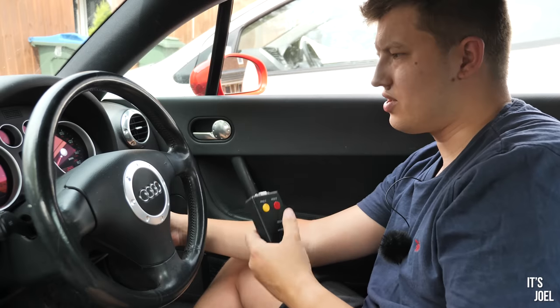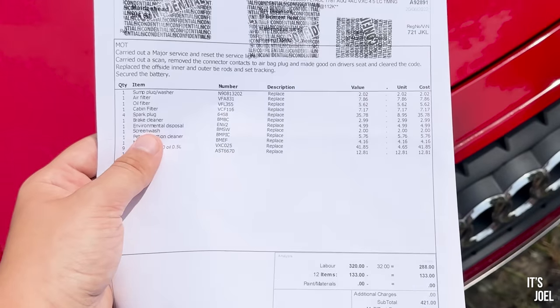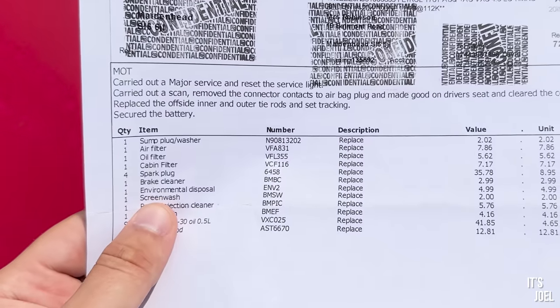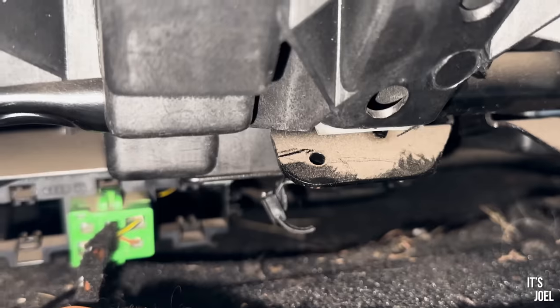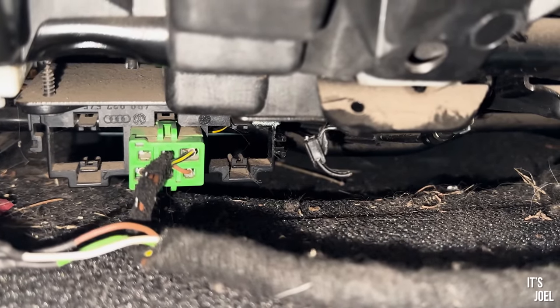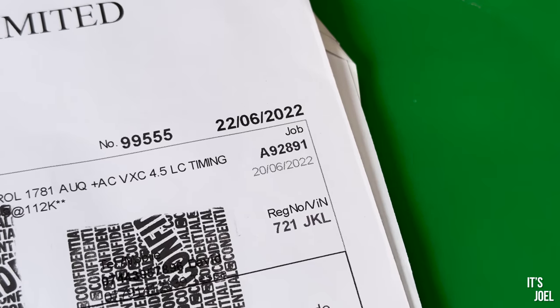I'm surprised it says 'success' on there - surely there would be a fail light if it hadn't worked. That's a little bit disappointing - obviously I was hoping this would be a very quick video where I just plug this thing in and it resets the airbag. Now I should mention what I've already troubleshot. I had this airbag light on, and in the service records that came with the car there are several documents showing the car being taken to a garage for this very issue, being investigated, and the garage fiddling with the connectors under the driver's side seat. The last time it was reset by a garage was about nine months ago, so obviously it comes back on very quickly.